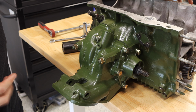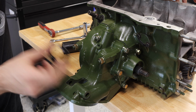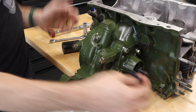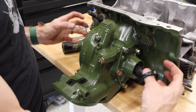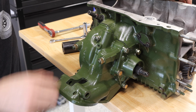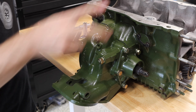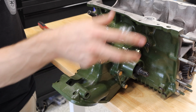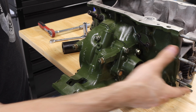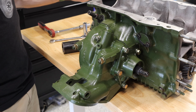Now there's only two real things left for this part of the gearbox, specifically the diff cover. One is installing the rubber seals for the output shafts here. Those are gonna go in, as well as the output shafts themselves. The actual coupling flanges themselves, I'm gonna go ahead and install those. And then we're gonna install the shift linkage that is used on this remote gearbox. And then the gearbox itself will be done. And then moving on into the next episodes, we'll talk about end float for the idler gear and getting that all set up for installing it on the engine.